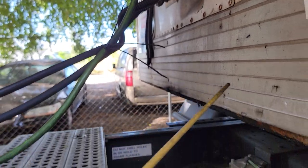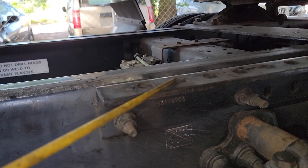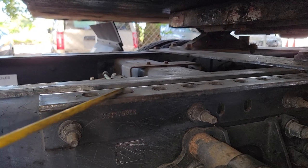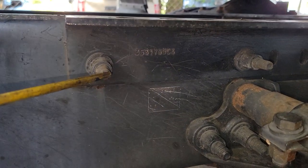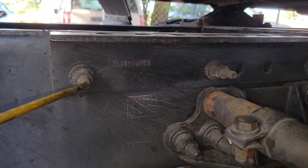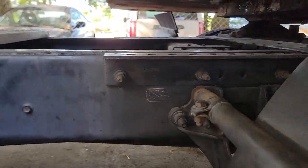We continue over here — we have our platform. The platform has no liquid, holes, weldings, no rust, no cracks. My platform is tied secure to my mounting bolts. My mounting bolts are not loose, not missing, they are in good condition, no rust, all present. Now we're going to go under the truck.